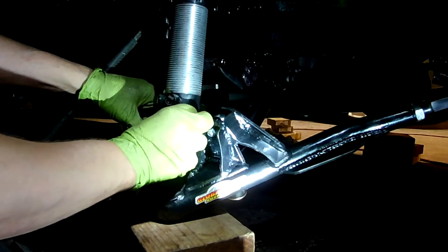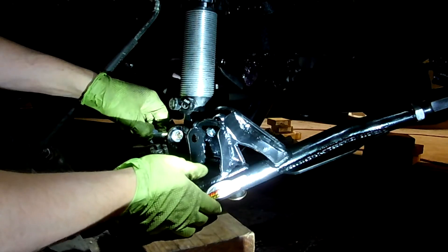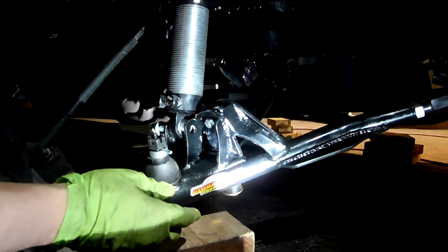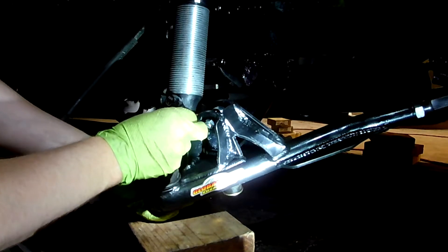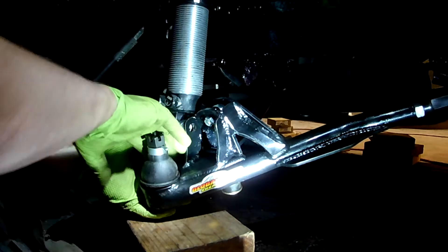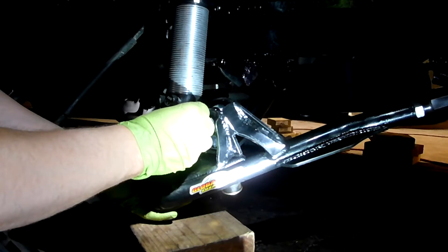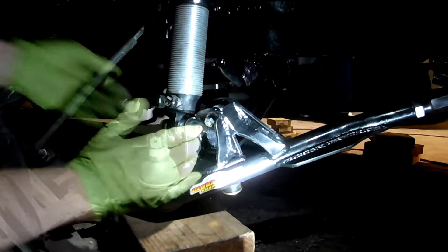If you have one of those telescoping magnets, it might be a little bit easier to hold the spacer in place. If I had to do it over again, I may have run a small rod through there just to get it all lined up and then push through with the larger bolt for final assembly. Once you get the spacer through one side and the bolt through the rotational bearing, you've got to get the shim in on the other side as well, because it goes on either side inside the actual mount. First side was tricky, second side a little easier. That keeps your coilover assembly centered and tight — those shims are important.